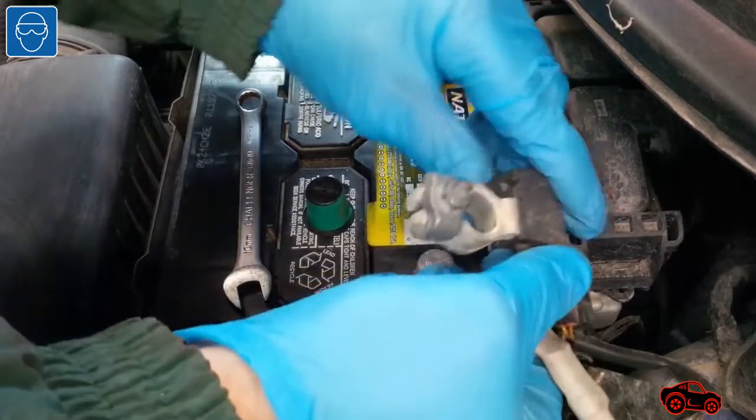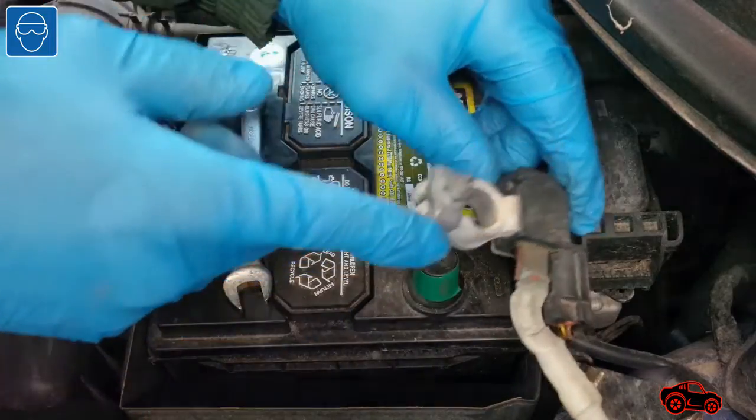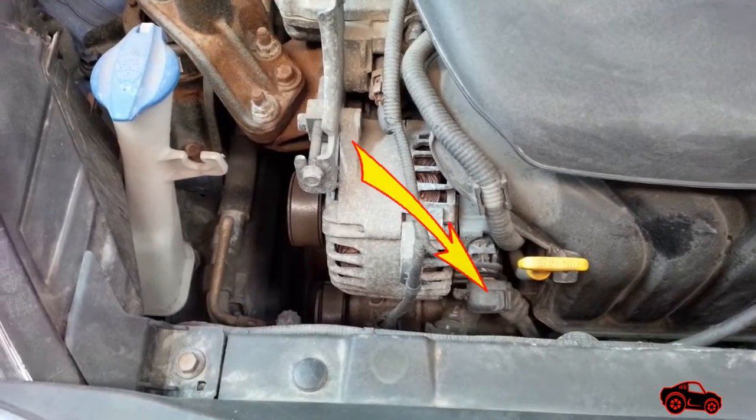With this kind of drive belt tension system, I preferred to disconnect the battery negative terminal. This procedure was to prevent any electrical short circuit with the alternator B-terminal.